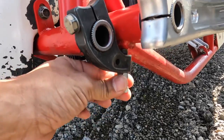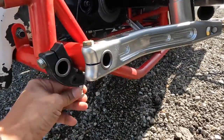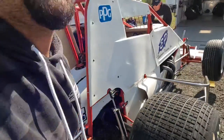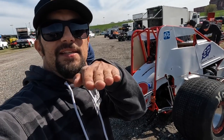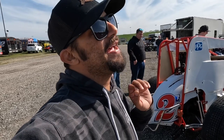So this is how we crank weight. When we start the night out, we put blocks underneath it and then just set these, which gives us neutral ride heights on the back of the car. A typical non-wing car you would do a half turn in the right rear and a half turn out of the left rear, just to give the thing some even tilt. That keeps you from loading cross weight. If the thing was really heavy, I would do double that — a turn in the right side and a turn out of the left side.